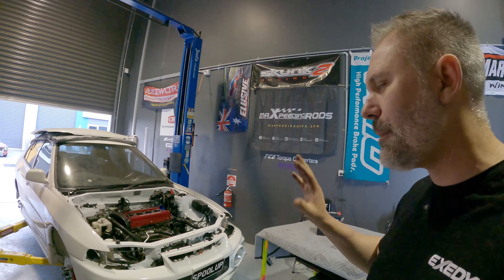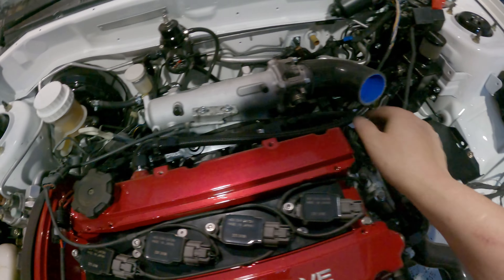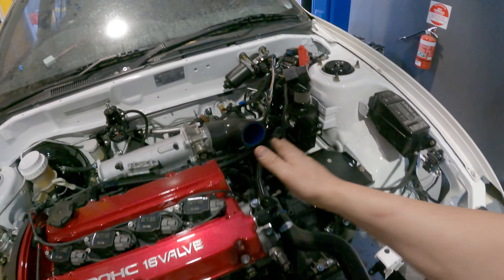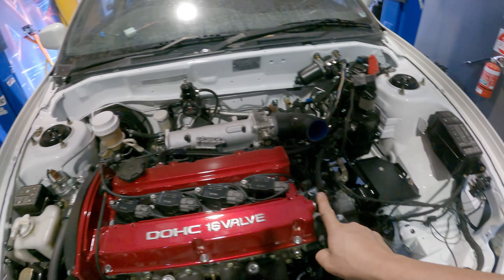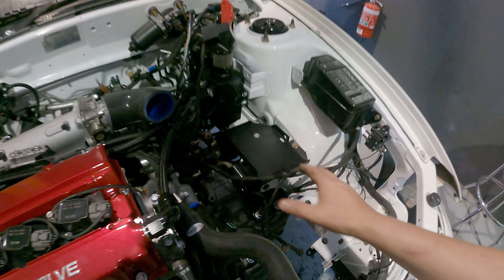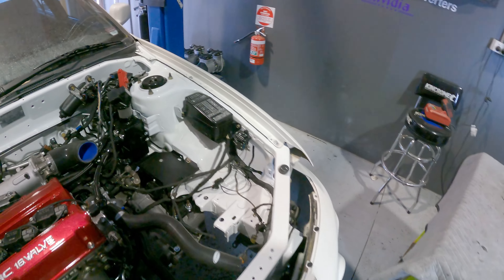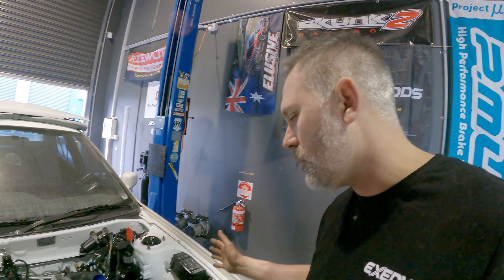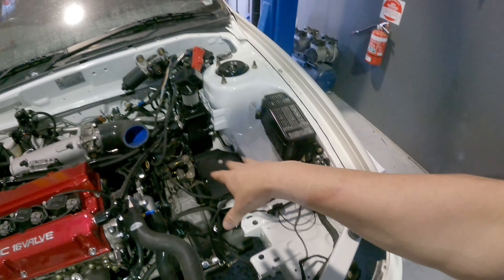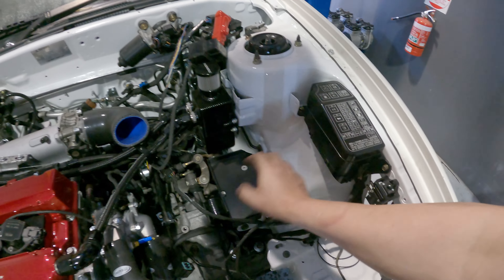Since the last video on the Evo, a couple of little things have changed. I've been doing bits and pieces here and there. I've made up the catch can lines and mounted the catch can — they're dash 10 off the rocker cover. I've still got to finish plumbing up the oil cooler from the bottom. I've got all new lines for that now, and I've gone ahead and fitted a battery tray. This battery tray is from Shift Performance — it's a Ralliart-style design that moves the battery, getting everything out of the road.